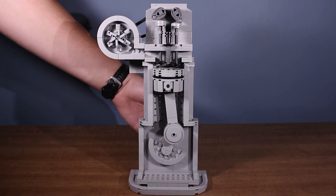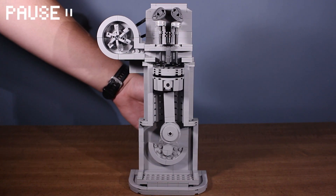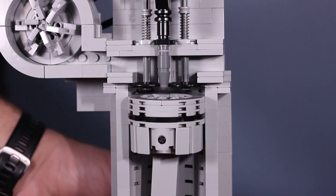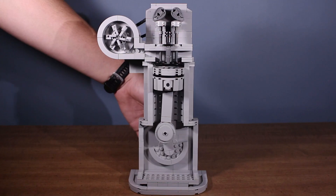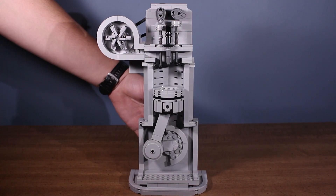When the piston is at the top of the stroke, or top dead center, the camshaft opens the intake valve. The piston moving down creates a partial vacuum within the cylinder, which pulls fresh air in. This air does not contain any fuel as it would in a gas engine — that's the job of the fuel injector. This is the intake stroke.